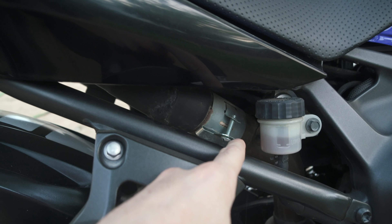And so then it goes into a three inch pipe all the way back up here and into the glass packs. It's pretty easy — it's not all that hard to do. You just need to know how to weld and fabricate some stuff. I can't show you because the seat and the cowl back here are on it. But when you pull off the stock system, you'll actually see on the top of the stock system there's a mount right under here that kind of mounts onto the back underneath the seat. So you'll have to fabricate that.